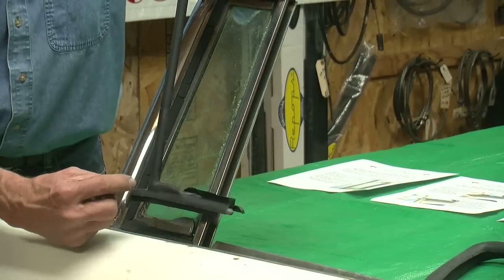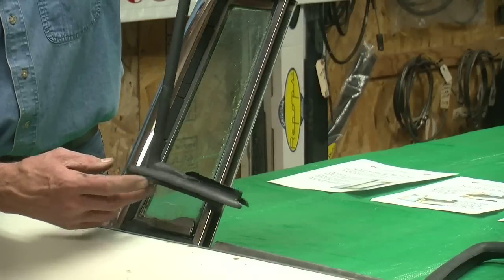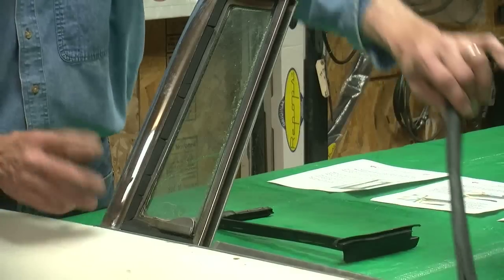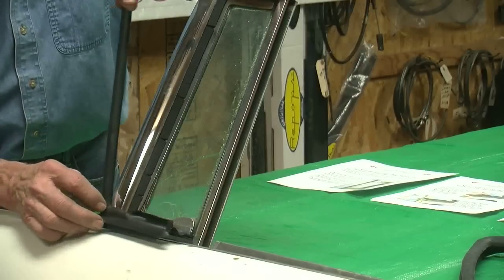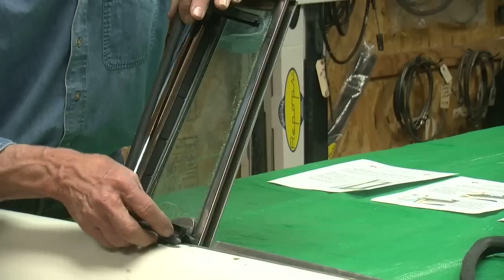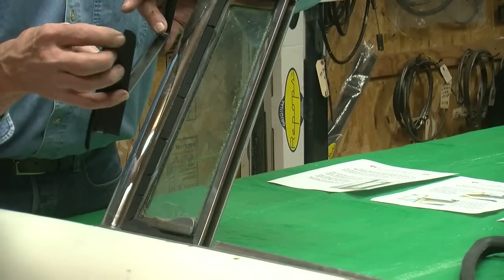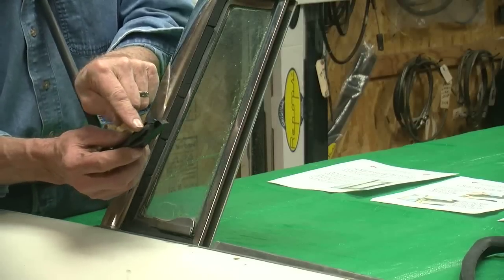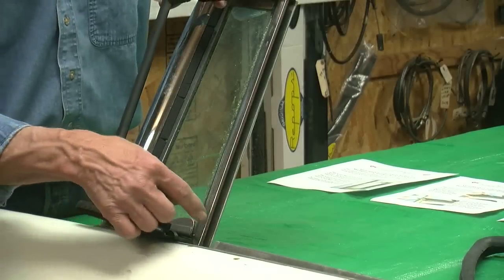Shorten it so that it's just a little shorter there. If you want it to completely match, you might want to cut this tail off right there — it's just a little flat piece of rubber — and then you won't have that. You'll have a nice square corner like this one. Your regular sedan wasn't that way, as you noticed — it was a rounded corner. So that's out of the question. You shorten this in relation to this pin, making sure this pivot pinhole is in the same place. When you shorten it, just square off the end. If you can get fancy, I would suggest you try to cut it notched here. There's a little flap here, and if you can notch it back and cut it so you still have a little flap, you'll probably end up trimming the flap down. It's doable, but it's going to take time if you want it exactly like the original.